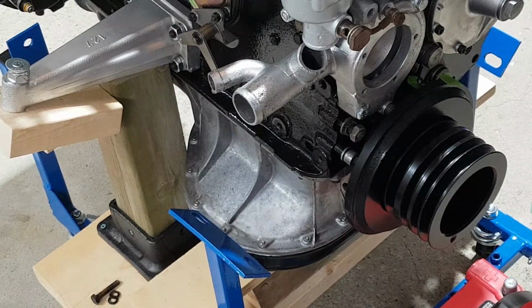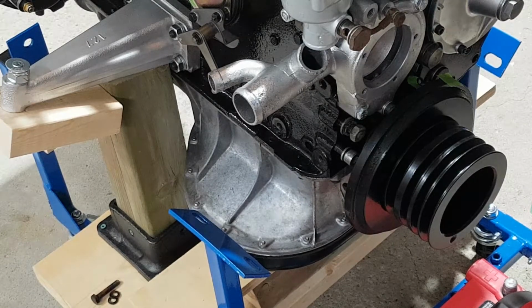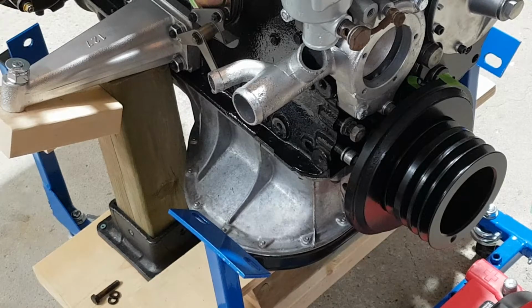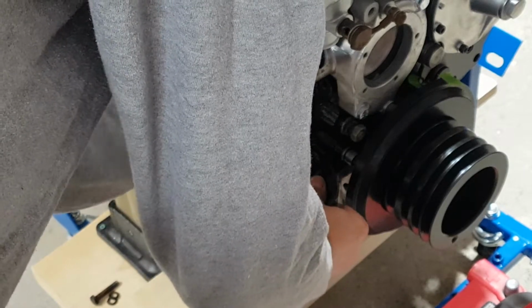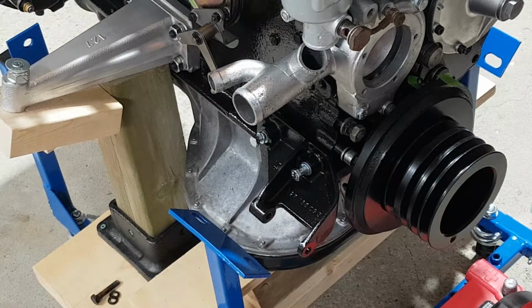Okie dokie. Got these guys coated here. I got the threads coated in the anti-seize, so if I ever have to take them off, or anybody else needs to, they are well protected. So what we're gonna do, remove this box away and put the bracket in. Should be able to put it in by hand as I cleaned the threads prior. Just gotta grab a socket. Okay, here's the socket, here is an extension.